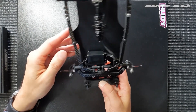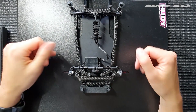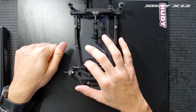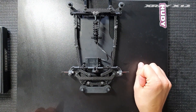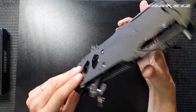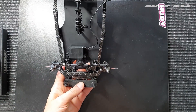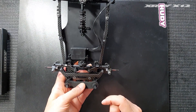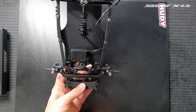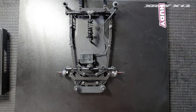When you want to move the steering links to the front Ackermann hole with the long wheelbase, you'll run into problems with the servo touching the arm, but there's a way around it. If you want to run the big servo with a long wheelbase and the forward hole, you need to flip the servo around and mount it at the back of the servo posts. You also mount the steering links to the back of the servo saver — this way you retain the same Ackermann without the servo hitting the arm, and all positions are accessible with both servo types.